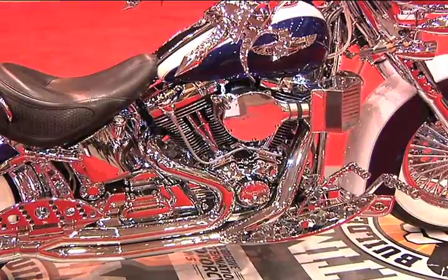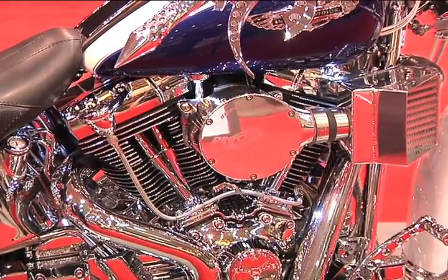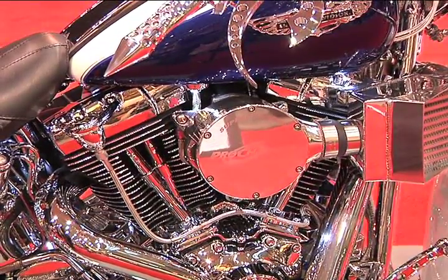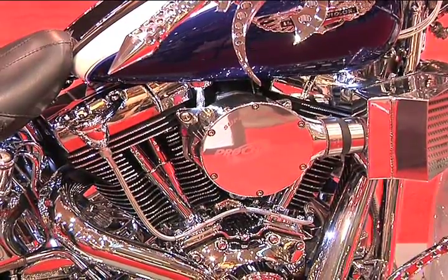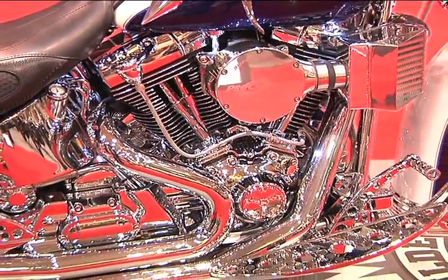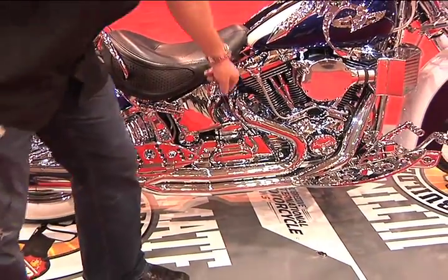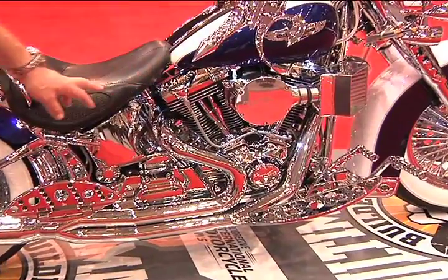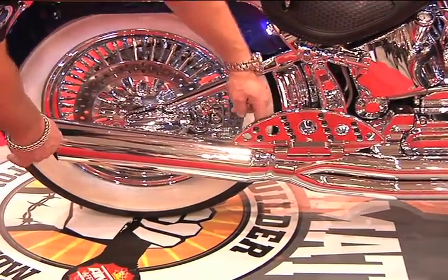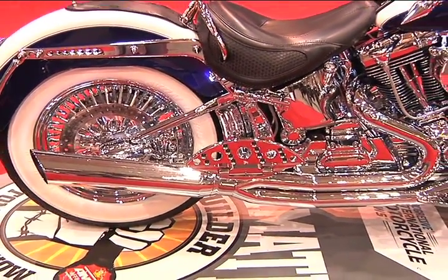You can go to his website at T-Man Performance — just Google search T-Man Performance and it'll take you right to his site where you can look at different grinds of cams, different kits, and different things for supercharged or naturally aspirated motors. To marry this all together, we went to D&D and got this two-into-one D&D Borzilla exhaust. This exhaust is beautiful — the first thing you notice is the arc on the pipe, because both pipes are exactly the same length to keep the back pressure the same, and then there's this huge collector in the back.